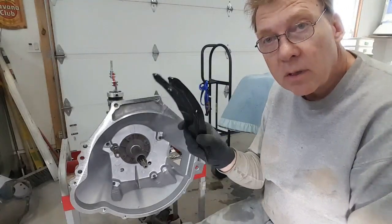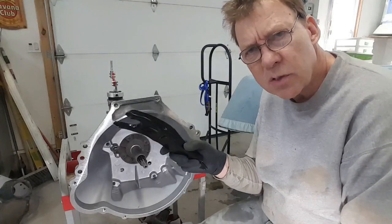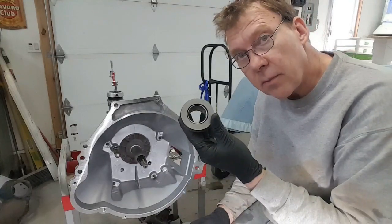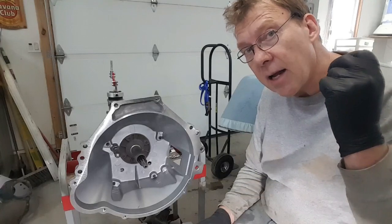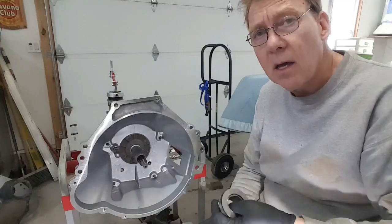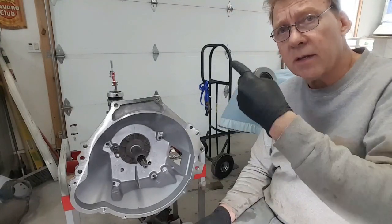So as I mentioned earlier, this is a clutch fork for a standard 1968 Mustang 289/302 small block manual transmission. This is the clutch fork for it. The throwout bearing is probably the same, but basically the kit I bought — which is the clutch pressure plate, the clutch friction disc, pilot bearing, and all of that — I had to do the research, I had to find out, make sure that clutch would go to the flywheel.